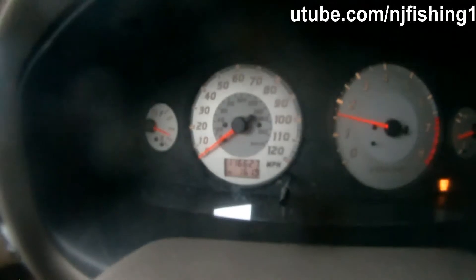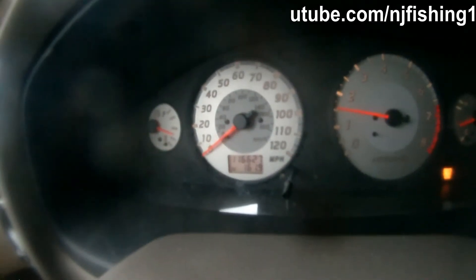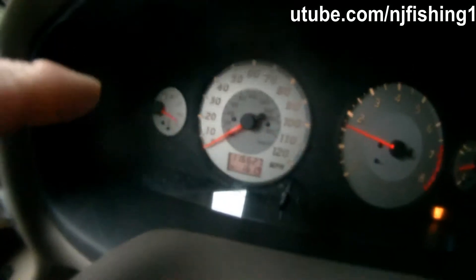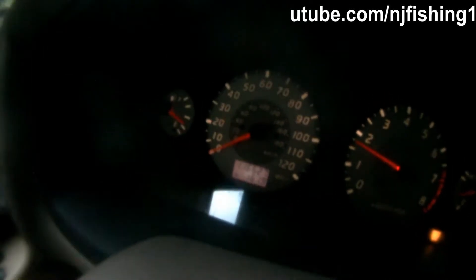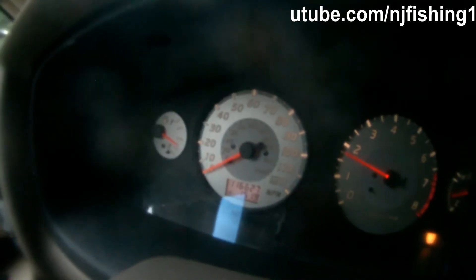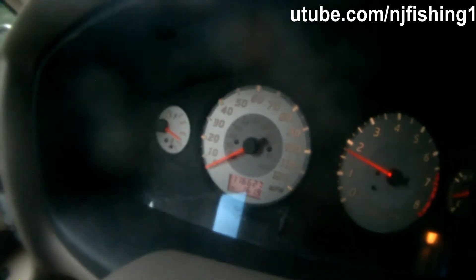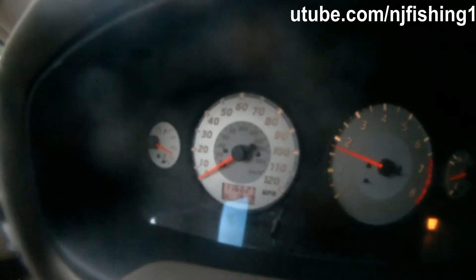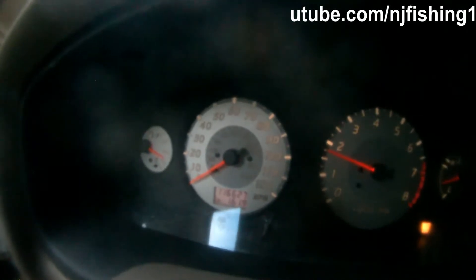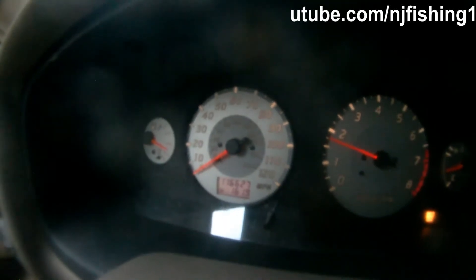You can see both the speedometer and the odometer are not working right now. I think it's probably because of the plastic wheel in the back of this speedometer and odometer — the plastic teeth are broken. That's why these guys don't move, stopped working. But there is also a good possibility that it's the speed sensor in my transfer case that's broken.